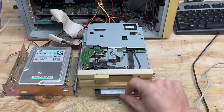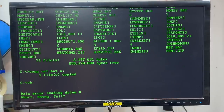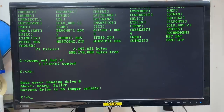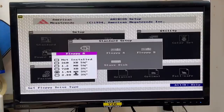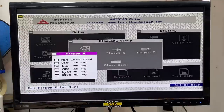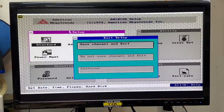Let's try the 3½-inch drive. Data error. There's no way that's a double density drive, not in the 90s. It just occurred to me that I didn't configure the floppy drives in the BIOS. Let's go ahead and reboot and set those correctly. We're still set to 1.44 on the 5¼-inch drive — no wonder we're confused. Save changes and exit.